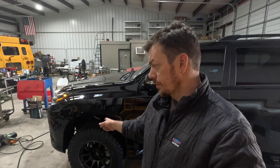Now, the lever ratio on the coilover to the arm is about 2 to 1. So if we wanna come down a half an inch on the ride height, that means we need to try to come down about 1/4 inch on our spring preload, roughly. So we're gonna shoot for that, and we're gonna be pretty close. Freaking KDSS, man, every time.